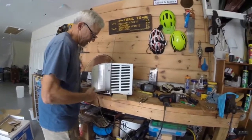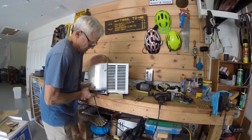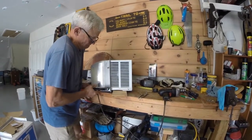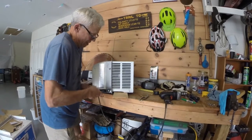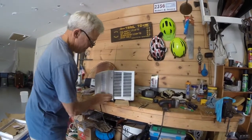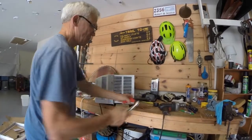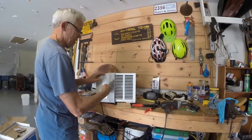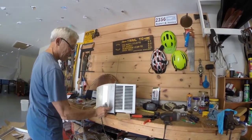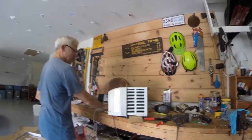See how nice and tight the fit is. Start your squeeze — one, two, three — okay, that's done. This one was just a placement hole, a number 30 one-eighth. I'll just put a little filler in there, and I'm going to do the same thing on the other side.